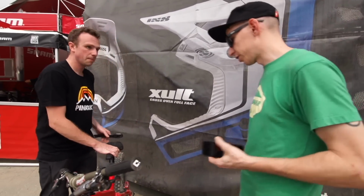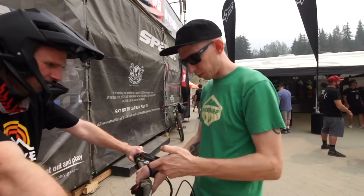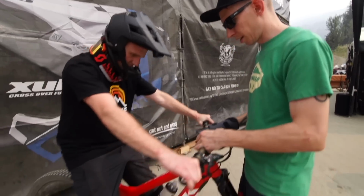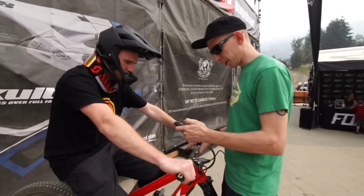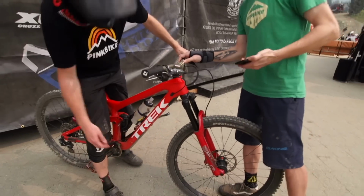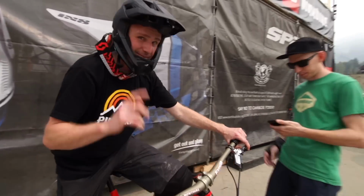And then let's check your sag just while we're here, because that's easy to do. How do you want to do it? Just sit down on the seat, just like normal. So it's like 25%, which is a little less. Scoot that up. Give it a couple bounces. Now bounce again on it. Ready? And put your feet on the pedals. Like 27%. So that's a good starting point for the park. Let's go with that. Put all your O-rings at the bottom, which you don't really need because you've got the app, but it's good to see. All right. Go for that lap. Cool. I'm gone.